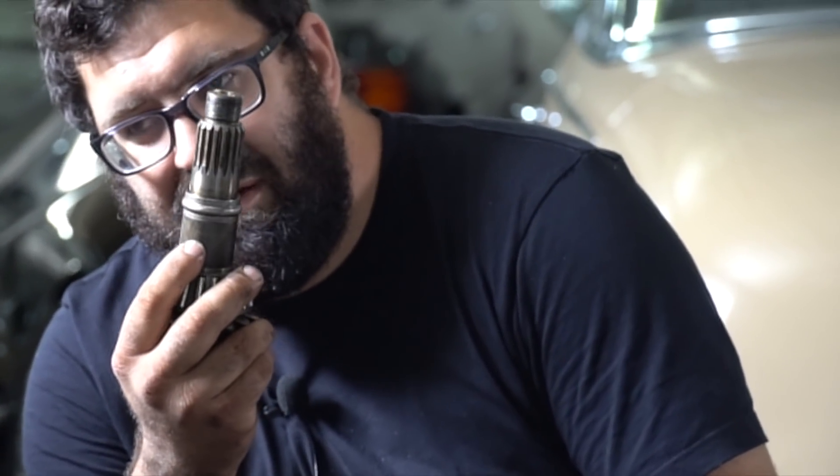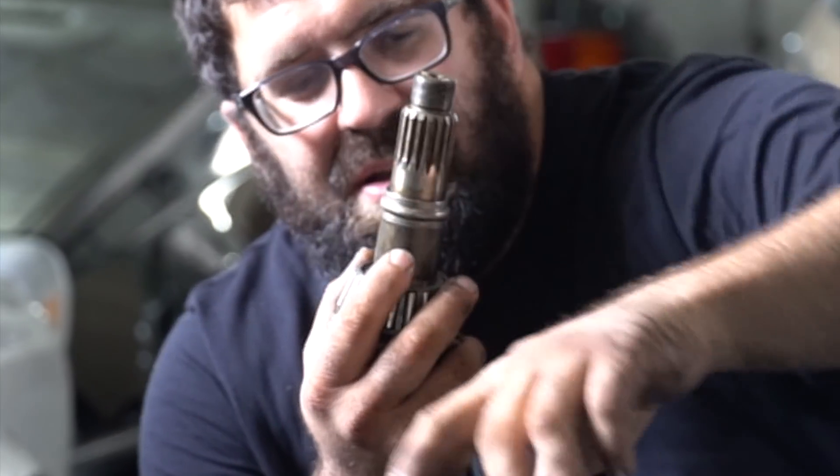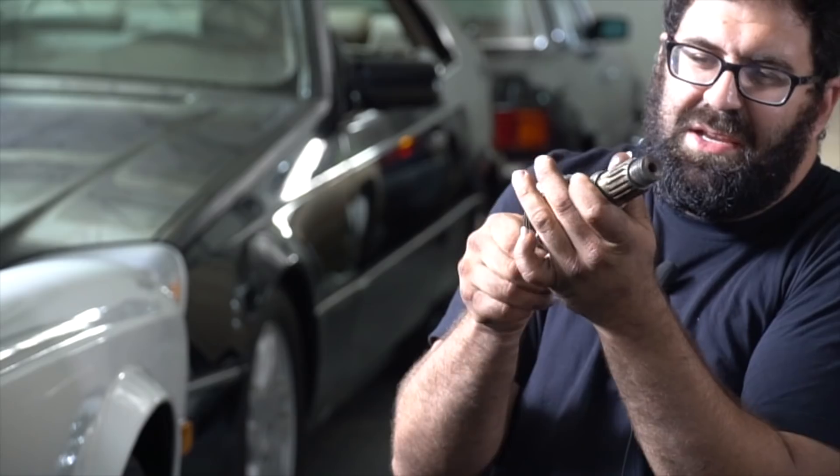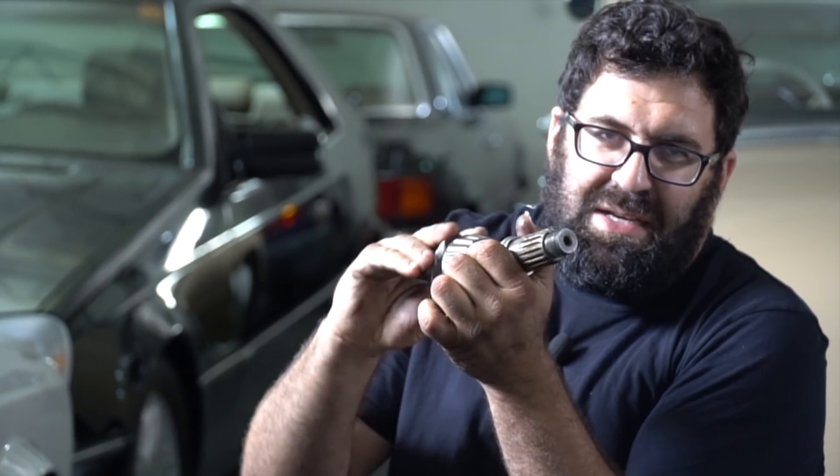When you put everything in, you have to make sure you can press the crush sleeve on the pinion to allow the entire rear axle to turn with only 14 to 20 inch-pounds of torque. If you hook up a tiny inch-pound torque wrench to the input shaft of the pinion when installed on the differential, you should be able to spin it showing no less than 14 and no more than about 22 inch-pounds — with no brake calipers, rotors, or wheels attached.